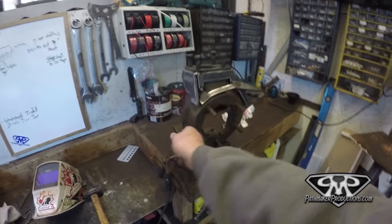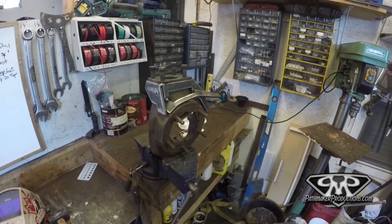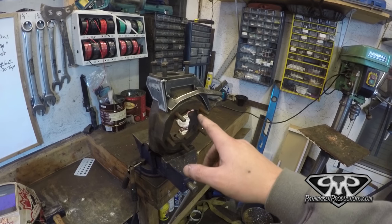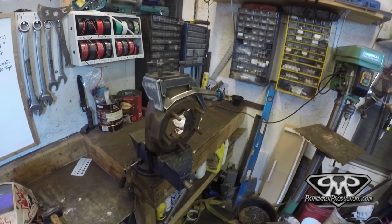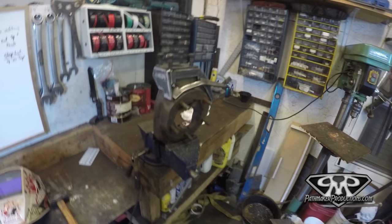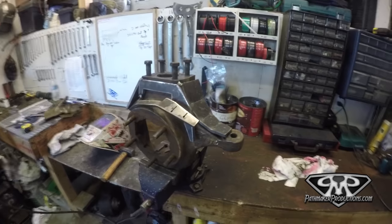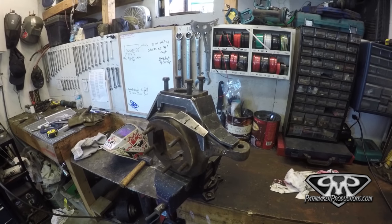The reason for the barbecue is this is a cast knuckle, and it will cool at a majorly different speed than the mild steel. If I would just burn it all in right now and leave it, some of these welds would crack because it would cool down too fast. So you get it good and hot on the barbecue, tack it all together, beat it all around, get it perfect, weld it all in, put it back on the barbecue, and let it cool down real slow. Some guys use kitty litter, buckets of sand, welding blankets — but I use the barbecue, and it worked mint on my 14-bolt tubes. I ran these bolts in just so I didn't end up with any welding slag in the threads.